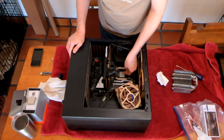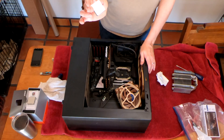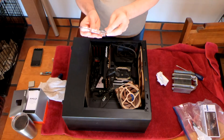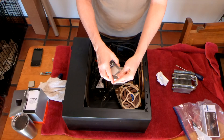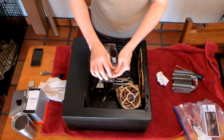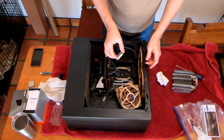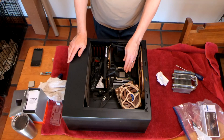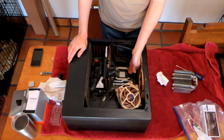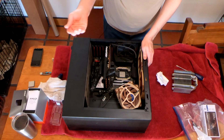Let's get it out of there. Pull that rod all the way up and it will be released. Here's the old CPU — the 3900X. Don't shock it or give it static electricity. See ya. Here's the new processor, the 3950X. When you put it in, make sure you get the right orientation — the word Ryzen is aligned with the top of the socket, and there's also a little triangle in the lower left-hand corner. Just put it in like that and then flip the bar down. It's really simple and easy.